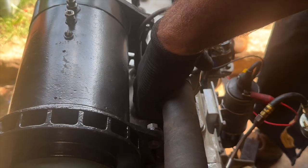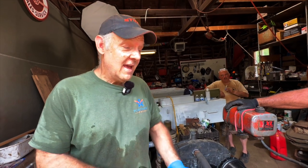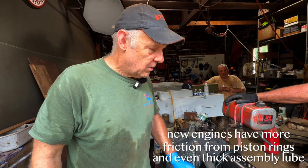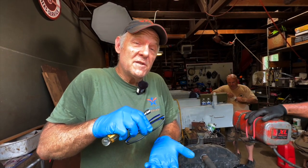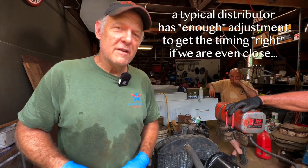It's better with his finger. Remember that top dead center for number one is top dead center for number one no matter what — it doesn't have anything to do with the distributor at that point. The way we do it is we put a finger on there and as compression starts building up, the engine is turning over. Matt's finger got blown off, which means the piston is rising, there's compression, and it blew it off. So we're close to top dead center — maybe a little before or a little after — but there's plenty of room to find top dead center at this point.